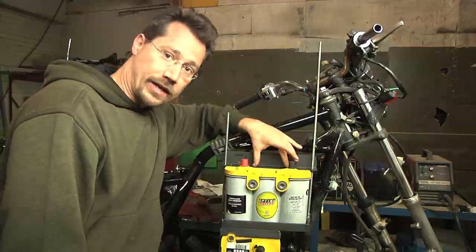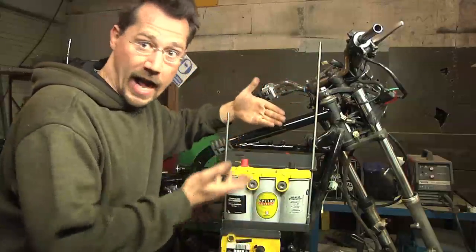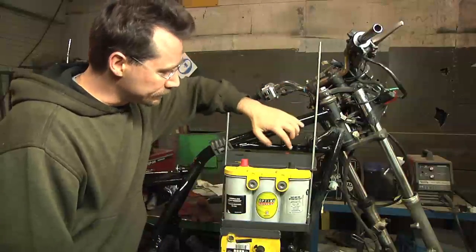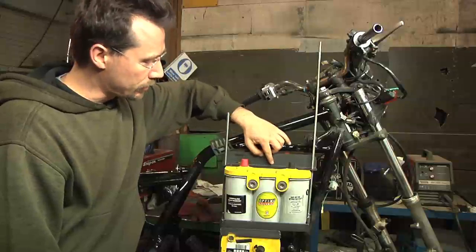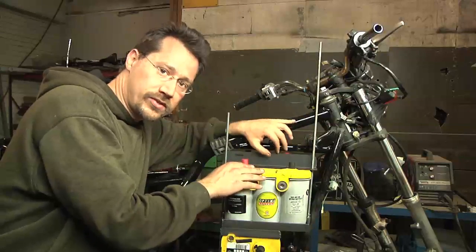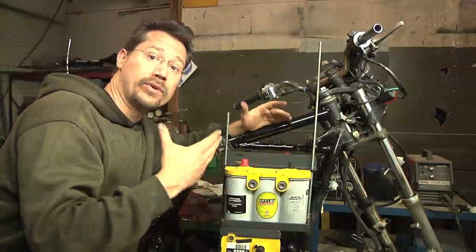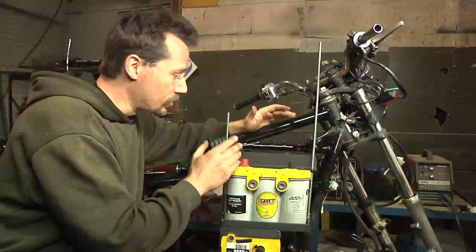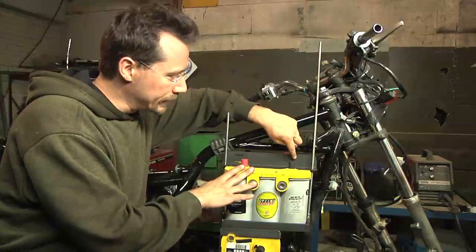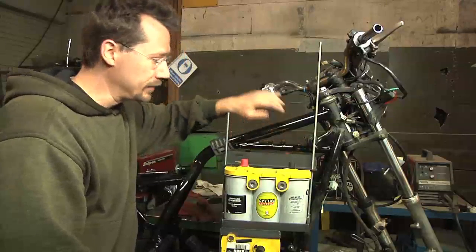It's very wide, it's got a lot of surface area to press against the battery, it's already painted black — that's hard to beat, it matches. And because it has this vertical part here and the gas tank is going to cover this, I could also use it as an attachment point for anything else I want under the gas tank — for example, the battery charger. I might end up drilling and tapping a couple of holes here so the battery charger mounts right up against there.